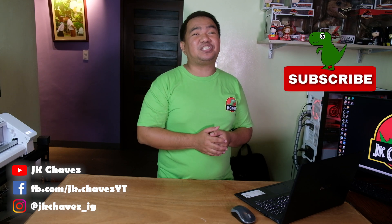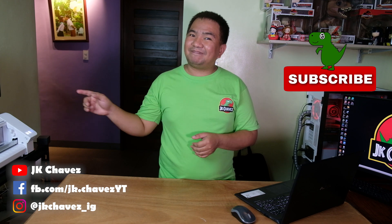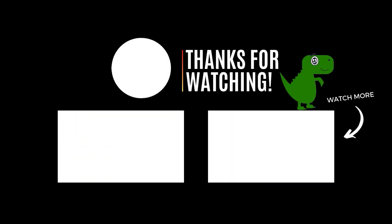As you can see on the 5 GHz test, we're getting the best connection possible. In conclusion, as much as possible connect to the 5 GHz WiFi frequency for better performance — you don't need to tweak anything, just set it to automatic. If you need the range, connect to 2.4 GHz and always check the best available channel using WiFi Analyzer. I hope you learned something from this video. Thanks for watching, have a great day, stay safe, and bye!